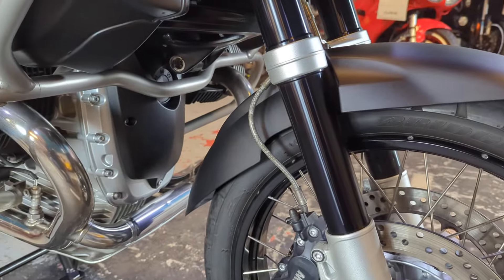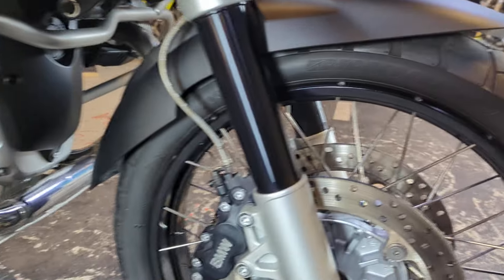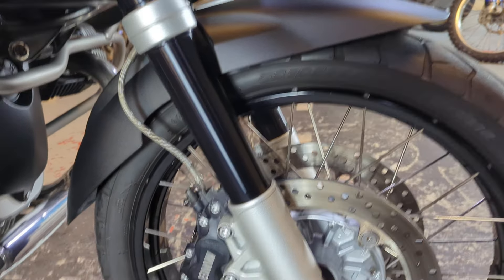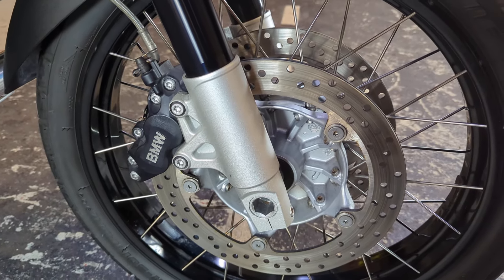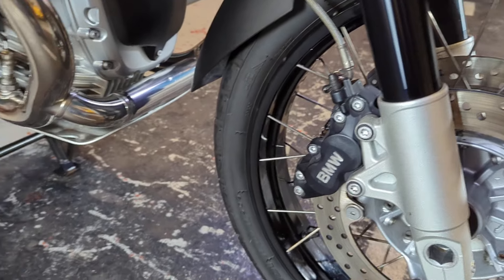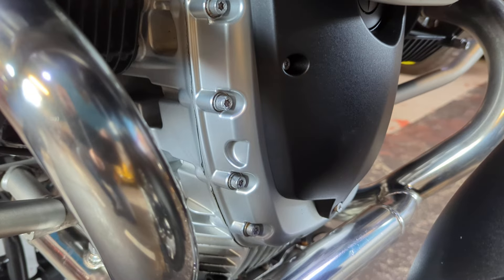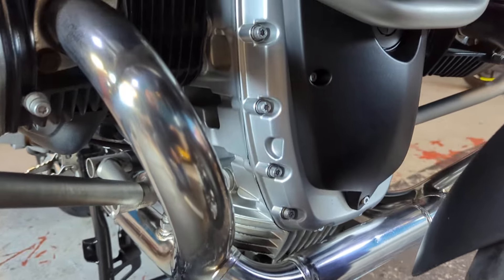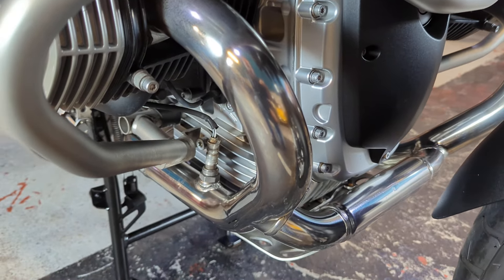On these GSAs, when you're looking at one of these older air-cooled, what are the things that stand out? Well, if you see a good one, the things that stand out for me - and we've had hundreds of them - hubs. Normally you'll see corrosion in the hubs at this age, and the hubs will be letting the bike down. Front cover also corrodes, and that'll let you down, mainly due to the fact there's a bit of sponge behind here and it holds water. It's a bit of a fault - well, it's just one of them things.